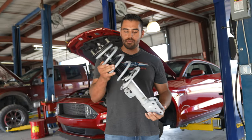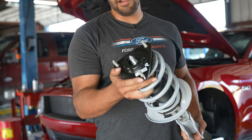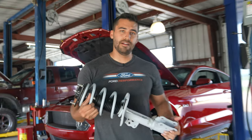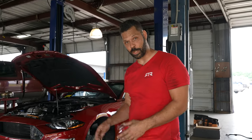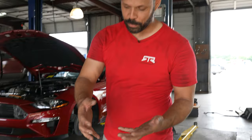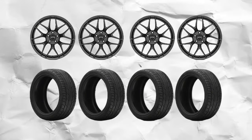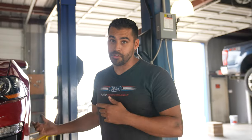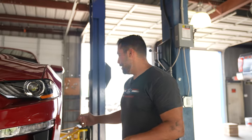We just got these back from Oscar — he went ahead and swapped out our springs and isolators and put the top hat on. We marked which side went to the outside and which was driver or passenger side so we know which one goes where. Now we're going to throw these in and change out the sway bar. Another reason it's useful to get this done at the dealership, outside of the factory-matching warranty, is you don't have to deal with the dirt, the cuts, the scrapes — you just pick the car up and head home with it. We got the bottom belly pan all buttoned up. Sadly our tires are delayed in shipment so for now we're going to put the stock wheels and tires back on to move the car. Once the wheels and tires come in we'll throw those on. After that we're going to put the side splitters on and that'll be it for today.